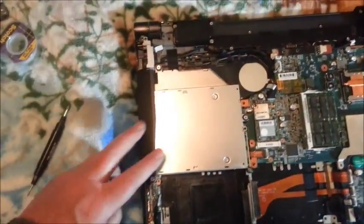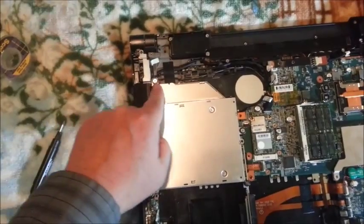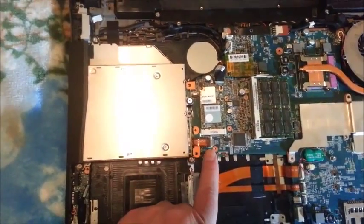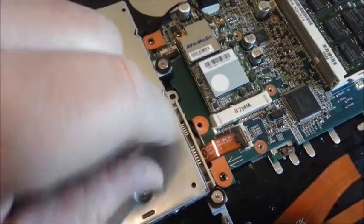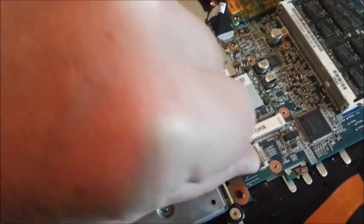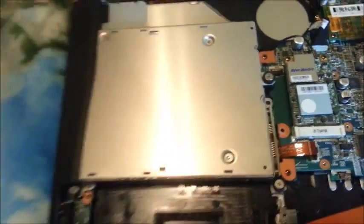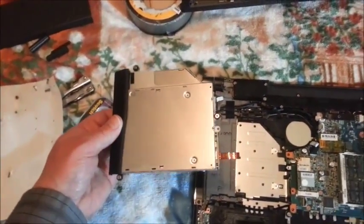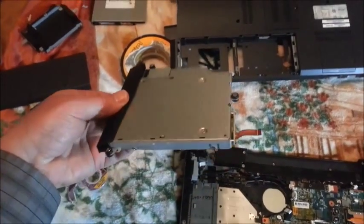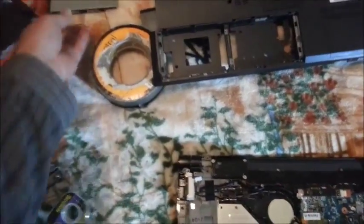Here's the Blu-ray drive. It's held in by three screws — one, two, three. We're going to take those out, and then it's got ribbon cables, so you want to disconnect this ribbon cable very carefully. All you have to do is put your fingernail underneath and flip up the little black tab very carefully. Now this should come right out. Three screws and it comes right out. Now we're going to take all the trim off of it — there's a metal bracket — and replace it with the new one.